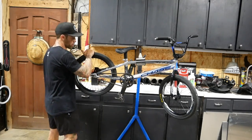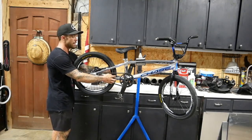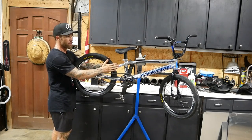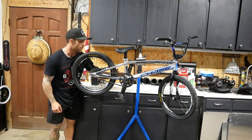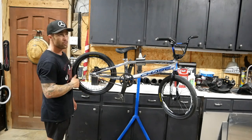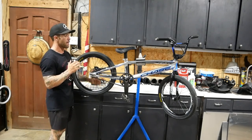Tires - we want fat tires on the freestyle bikes. Fatter tires give you a little more cushion on such a rigid bike. So this one took some testing. If you guys have a Chase already, you'll know it gets pretty tight on the back wheel. There's not much room for a bigger tire than say a 1.75 or 1.85 because this is a race frame - it's made for racing, so they don't allow a lot of room for a fat tire. The Maxxis Grifter 2.10 is an exact fit, which literally gives me probably two millimeters on each side. That's the fattest tire that can actually fit on here. If you try the Grifter 2.2 or 2.3, as soon as you inflate it up to 80 pounds or more it's going to rub the frame and stop the wheel from turning. But the Maxxis Grifter 2.10 fits prime time and feels good on the trails and the park.